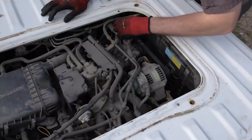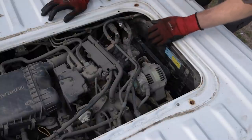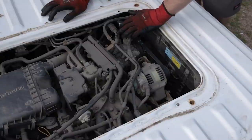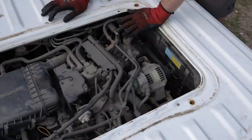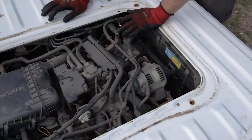No noise from the high side valve when I removed the cap. Normally when I don't know the condition of a system, I'll do a full recovery, and once I do the full recovery I'll go ahead and just replace these Schrader valves. They're very cheap — might as well put new ones in so you're not chasing your tail. When you do leak tests on the system, you can check every bit of the system except for these caps, because that's where your service port hooks up and you can't check for a leak right there.